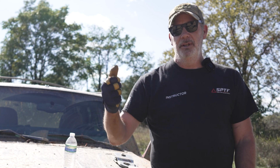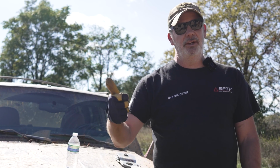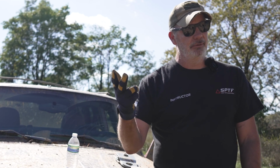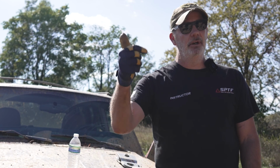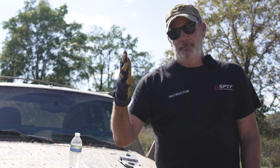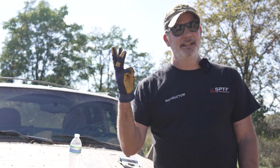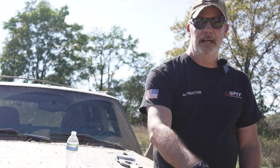So I always tell people, once you get stuck, stop, secure the vehicle, make sure it's safe, get out, figure out why you're stuck, then pick your mode of recovery. Is it gonna be a winch, kinetic rope, strap, high lift jack? Come up with a plan, then execute that plan, boom, you're done. Have one person in charge, not 3 people. You know what that's like. You're gonna have 3 people telling one guy what to do. It gets to be a mess, and it's analysis paralysis time.